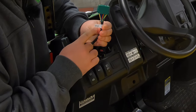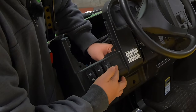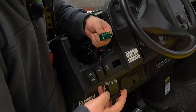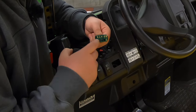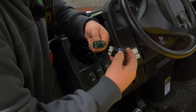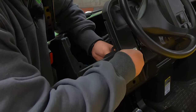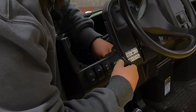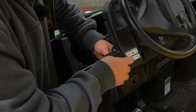Another open plug we'll have is this green one that has the symbol matching our turn signal switch. We'll reach back behind — the turn signal switch goes right here — and pop that plug out. Then take our switch, match up the prongs with the terminals in our plug. You'll notice the terminals have some grease in them, so just match up those prongs carefully, slide that through, plug the switch in, and push it down firmly until it seats. You'll hear that click.